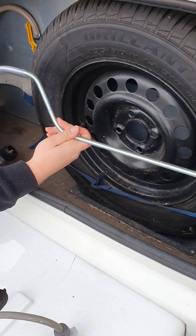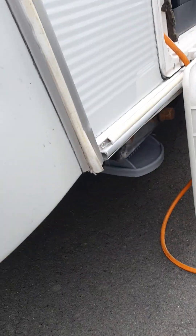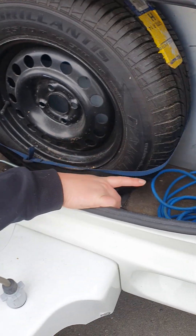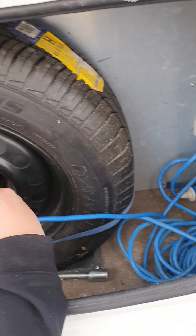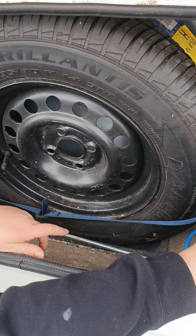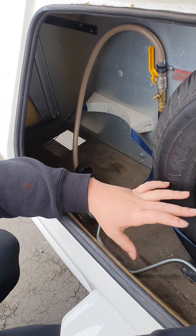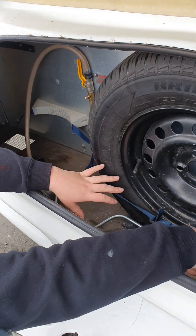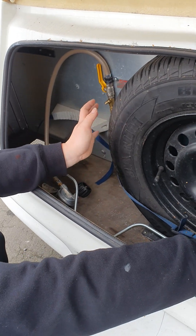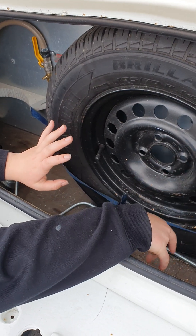Just remember to open the gas back up when you want to use it again. You've got a leg winder here for all four stabilisers on each corner of your van. On the right-hand side is your power cord for when you're wanting to plug into a campground. You will notice there are some grates on each side of this locker — they are open to the elements, so don't store anything in here that you don't want getting dusty or damp. These lockers have a payload of about 20 to 22 kilos, so don't overload them as it will affect your towing and the structure of the van.